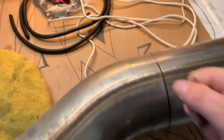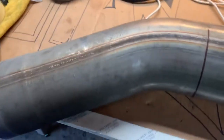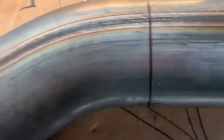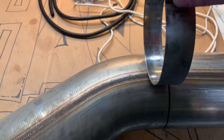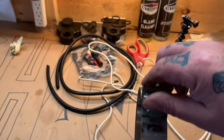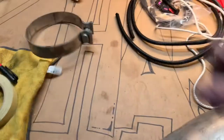When you're cutting your exhaust pipes, you want to obviously have your cut straight so you're not trying to squeeze that tip on a piece of pipe that's cut crooked. Use a clamp — get your stuff measured out. I slid the clamp around here because it's pretty much perfectly straight all the way around, it's going to give you a nice straight edge to mark your pipe with. Slid the clamp on there, squeezed it together, held it with my pliers, tightened it up, and put my mark, and then you got a straight line all the way around.